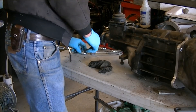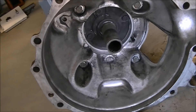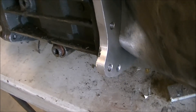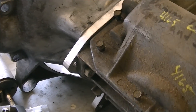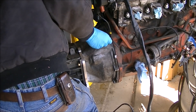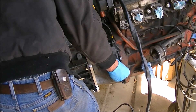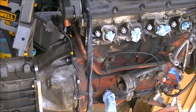There's the final product — that's not the final transmission; the transmission I have is in much better shape. This was an old scrap one with a couple bad synchros that needs to be rebuilt. I've got one nice clean one that's going to go in. You can see the additional holes — if you were to rotate the bell housing and the transmission to orient the engine at a slant, you can see how you could use those other holes to bolt things together. There's the whole unit, and now I'm trying to fit it up onto the engine. Fortunately there are some dowel pins in the engine that go into holes in the transmission, and here's the final result — looks like it bolts up nicely.